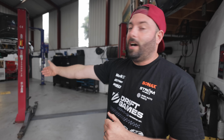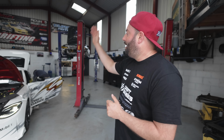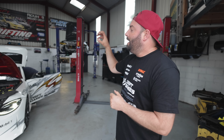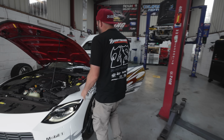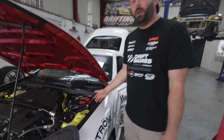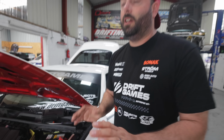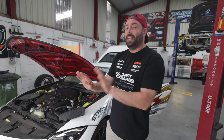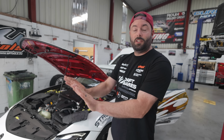Right now, we've got my team, which is a ragtag team, because Wayne isn't back till tomorrow, of Gary, Dunn and Toby. So what we're trying to do now is do the interior of the car and go through all of the fuse boxes. What we've researched is we need to pull the brake fuse from this fuse box. There's a stop system under the pedal in modern Zs, which basically means that if you left foot brake, it thinks you're accelerating and then crashing, so it shuts the car down on ABS.